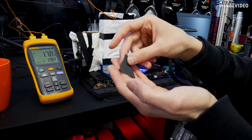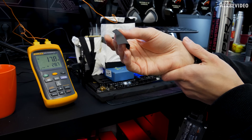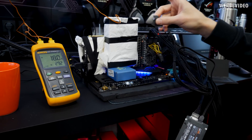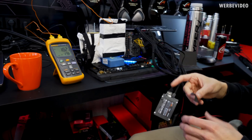Typically if you compare Carbonaut with Cryonaut the result will be worse — even 0.2 mm thickness is too much compared to a normal thermal paste for better resulting temperature. But the benefit is that it cannot crack, it cannot dry out, and it cannot harden. We will try putting it on the container and see what happens if we go to around minus 180 degrees Celsius. The purpose of this pad is for lower-performance parts — like a Ryzen 5 or even laptops — where it would be a really good solution because it cannot dry out. You'll have maybe three degrees hotter than Cryonaut on a CPU, but it will always stay the same and you don't have to repaste it, which is a really good point for this product.